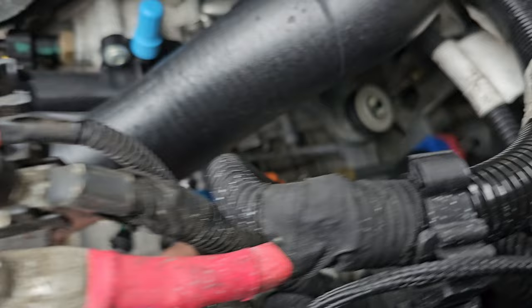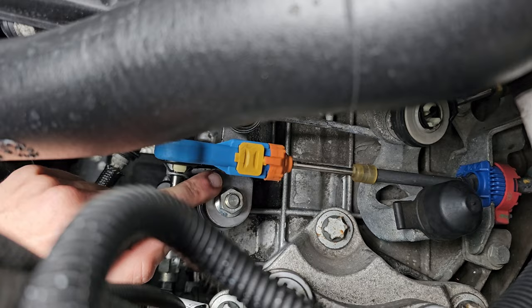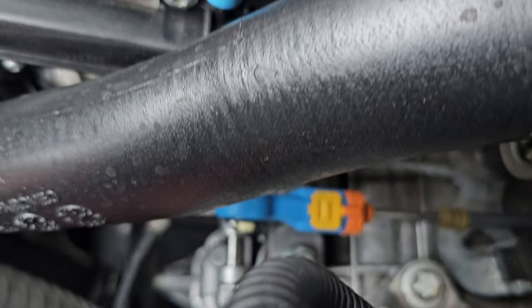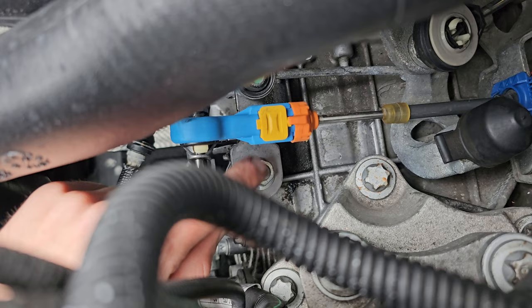And then just this bolt. But we don't want to be moving this around too much in there. We want the new one to go on in the same rotation. The way I'm looking at it, standing out my engine bay, it's facing 9 o'clock, and we want it to stay at 9 o'clock as well. So in the instructions it says to knock that end off first, which obviously you want to do, and then hold grips against this while you're under that, but I don't know how tight that's going to be.